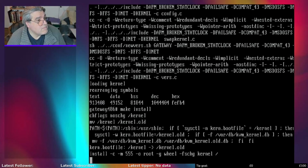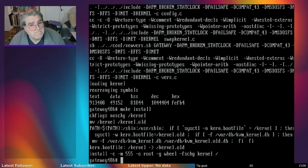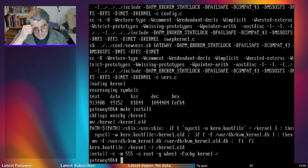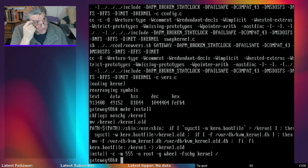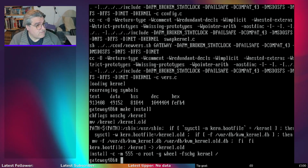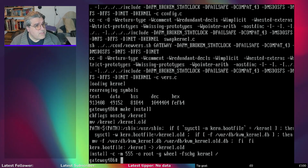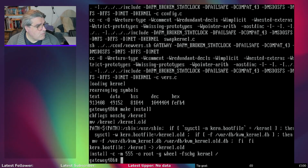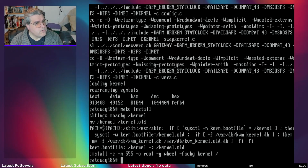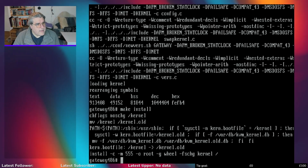Windows on this streaming computer has a bit of an issue, and I think it's network related, because it's always TCP/IP.sys that crashes, and it's always driver IRQL not less than or equal, is the error. So I think it's the onboard network card on this motherboard is iffy, or the drivers for it. It always crashes in the same way.